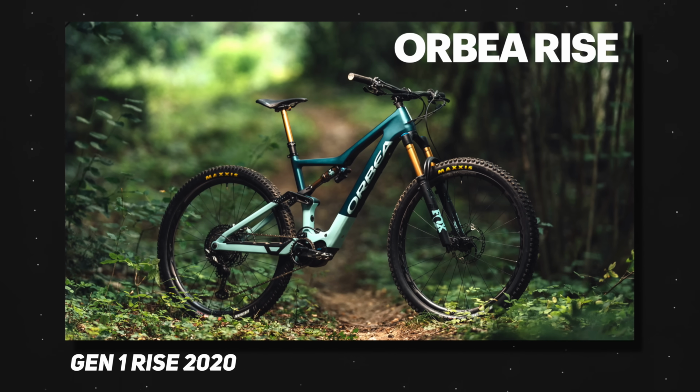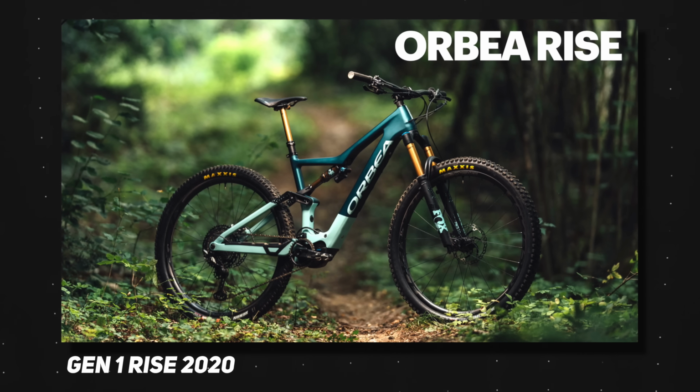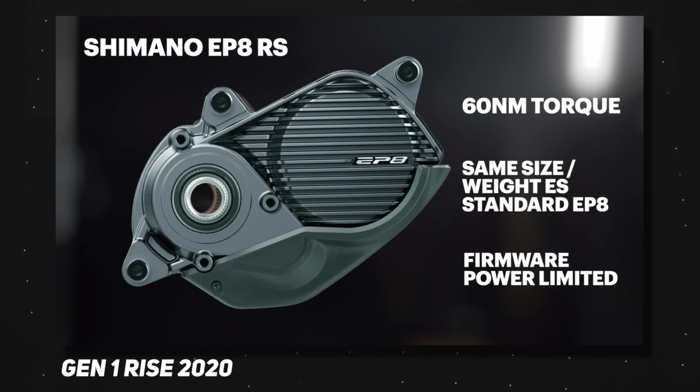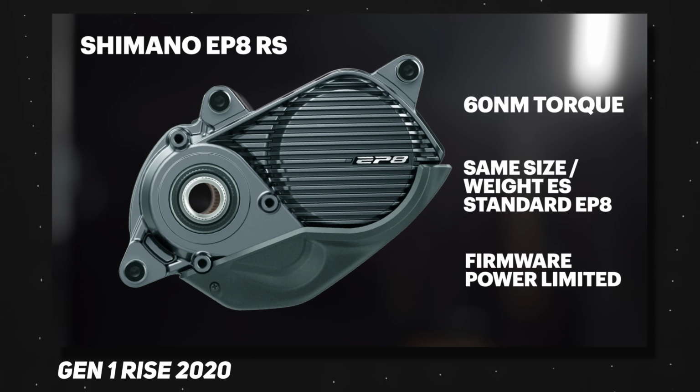And then later on in 2020, Orbea announced the original Rise. And like the Levo SL, that was a super light e-bike, around 16.5, 17 kilos, with the Shimano EP8 motor that had a custom tune that Orbea and Shimano collaborated on to bring a lower powered version of that same EP8 motor that normally runs at 85 Newton meters of torque to 60 Newton meters of torque. And instead of offering something like 35 Newton meters like Specialized did with the Levo SL, it offered 60 Newton meters of torque, so almost double what you got from the Specialized Levo SL.